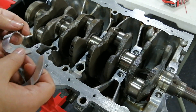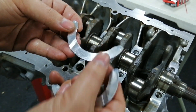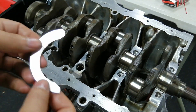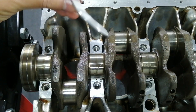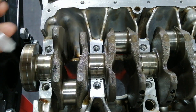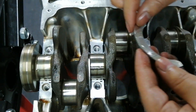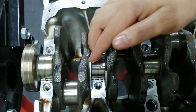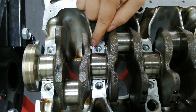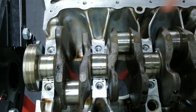One very important thing not to forget is to put in these thrust washers. The grooves always face outwards so they can trap oil and keep this area lubricated — these ones face the crank. I'd recommend putting some oil on the surface but not on the back surface. You can see they fit flush. Then when you put the girdle on, it will keep them in place.